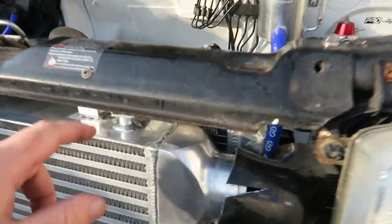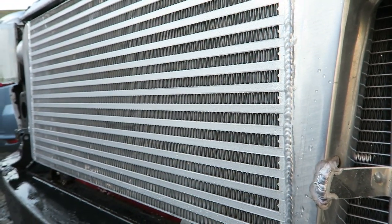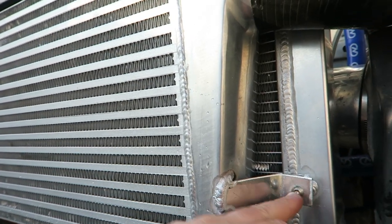The van's back from AutoStyle. I've just had the brackets fabbed up for the rad and the intercooler. I've gone for a 3-inch intercooler with a nice thick core. Should hopefully give me cooling sufficient for about 600 horsepower — it should be fine. If I ever need to, I can swap it out and I've got these mounting points here.